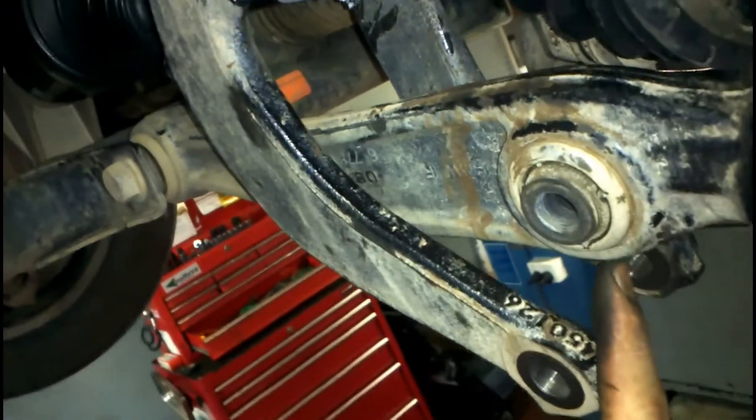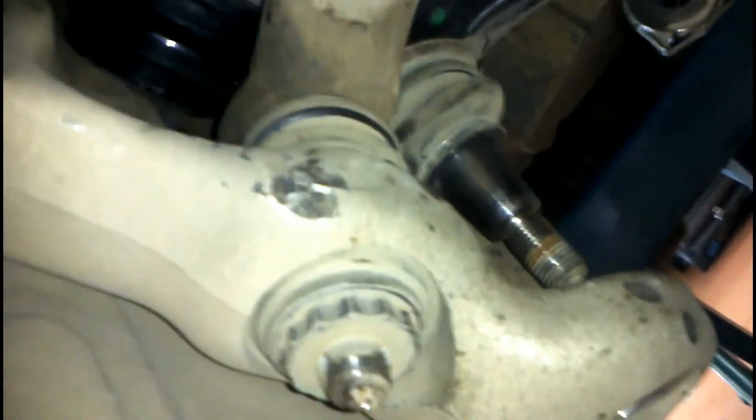It takes a bit of hard yakking to get that shaft back in, but you guys can do it. Just got to make sure your arm is in the centre there. Around this side, those ball joints are pretty hard to get in. Just got to make sure that these shafts are square in the holes — otherwise, if they're cocked to one side a little bit, that 27mm double hex nut is so broad that it can't get into the hole it's meant for.